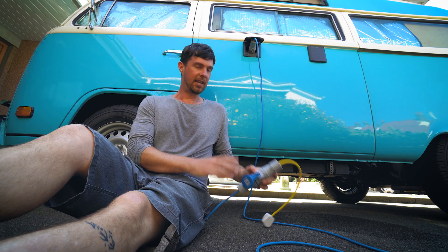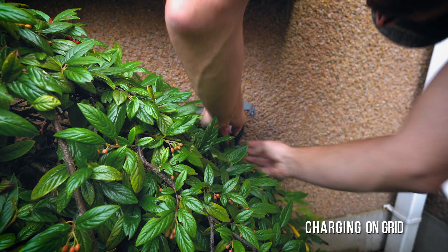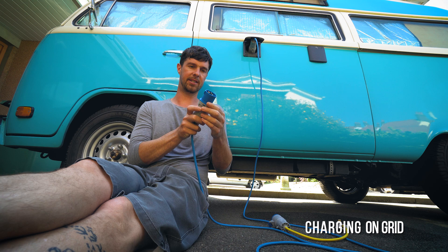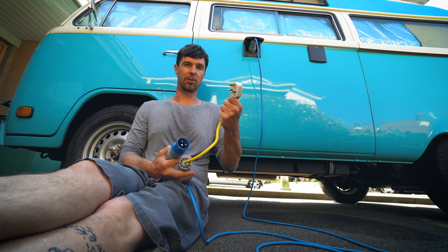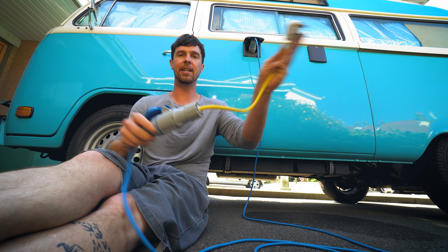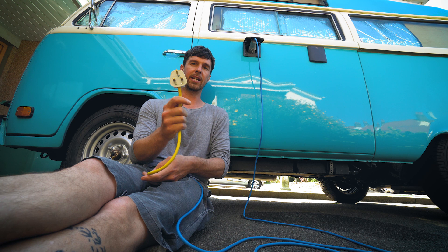In reality we're not going to be on grid all that often, but in situations where we're at a campsite on a cloudy day and can't rely on solar, we'll be using a hookup. This is designed to go into most UK campsites — it's IP44 rated, so it's waterproof, and it's a 16-amp connection. When parked outside someone's house we'll use this adapter we made up, which lets us plug into any standard UK house socket. If we're not in the UK, we just swap the plug top — I've got a European one — and we can get a local plug top wherever we are.